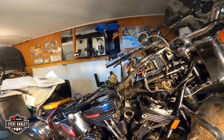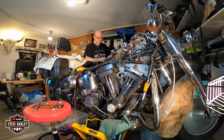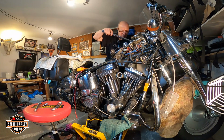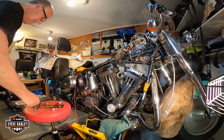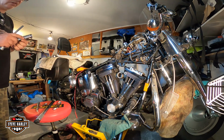All right, let's do the Allen bolts. Okay, I just hand tied the Allen, so I can fit in there, but I will check. It's 15 foot-pounds to 18. So let's put it here for now. Let's see where we are, if I can fit one. I have no idea. Alright, I'm not going to take my chances. They are quite tight. I don't want to ruin the bolt. Okay, let's go to the next step.